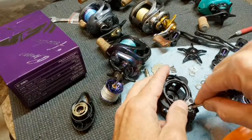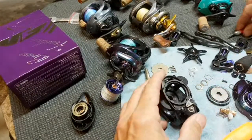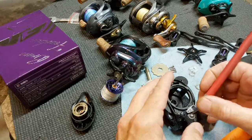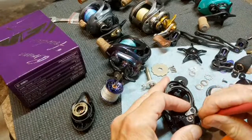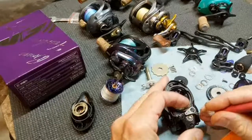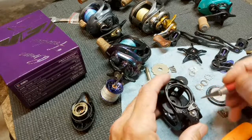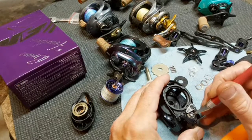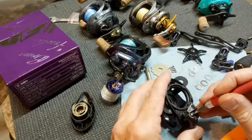Just to see what's in there. Now, sometimes I'll give you a C-clip with enough room to get something in there, like an X-Acto or whatever. You got to watch it. This is the one thing. RC cars used to have these all over them on the hinge pins, and it was a nightmare. I usually try to push it off into something, so it's not going to go ping, flying off. So we're going to pop it off, push that out. And this is where you got to keep track of what's what. Usually there's a little bitty one, could be just one big one, or there's usually at least one big washer in there.